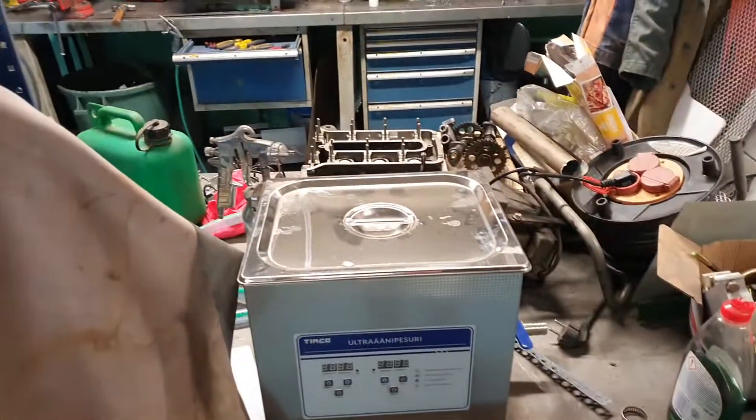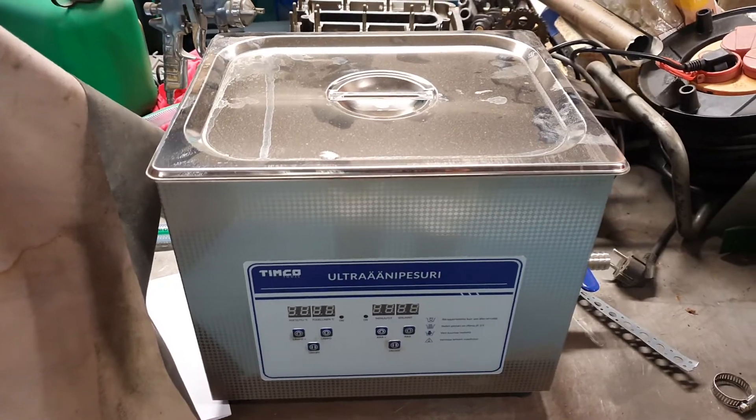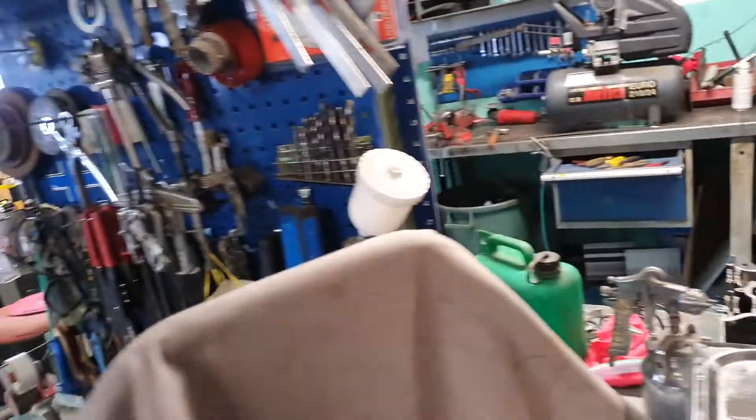A vacuum line that's missing or broken, gaskets — those are important. On my bike, a three-cylinder BMW, I found four places where I had false air. It's 30 years old. I'm not saying the BMW is bad, but those air leaks are the thing to check first.